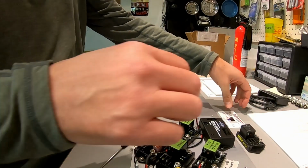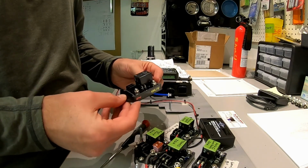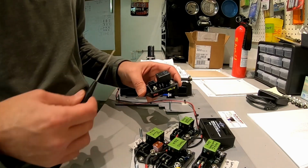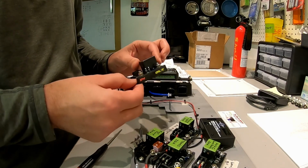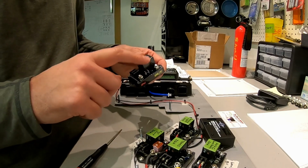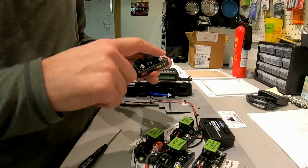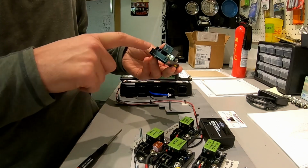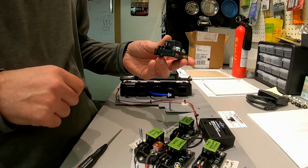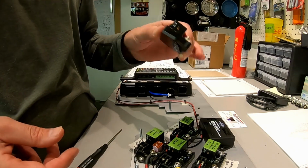The relays that I'm using are from Leash Electronics. They just have one relay module. He also has some duals. He also has multiples. They get more expensive as you go. These are $25. They don't come with the fuse, you pick the fuse that you want. Set it up: basic 12 volt in, out to your source, and then you've got a ground and your power for the relay. Very easy to wire. Very nice little modules if you guys are looking for something clean.